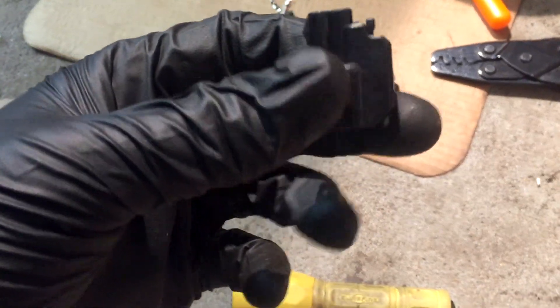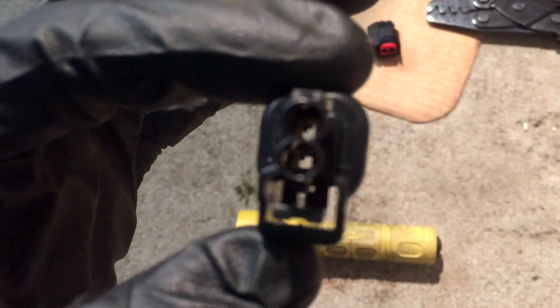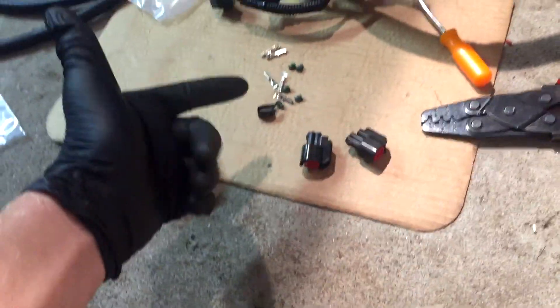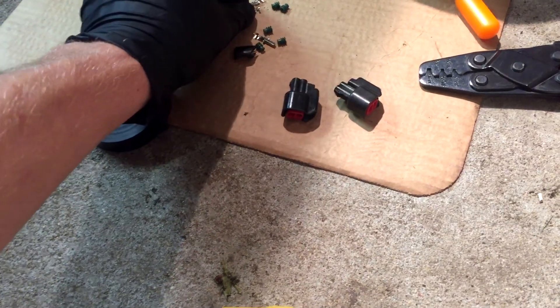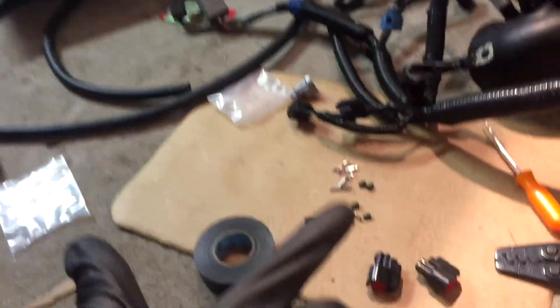The injectors have a universal connection and the kit comes with the connectors. Injector Dynamics has a video on this, so definitely check that out — I'll post a link. The plug isn't as obvious as some plugs in terms of how to orient it, but their video has really nice pictures. To avoid buying the plug-and-play harnesses, they give you nine total crimps and weather-protectant connectors, so you have one mulligan if you make a mistake.